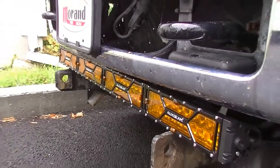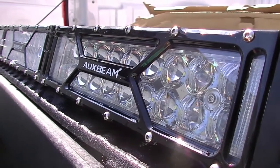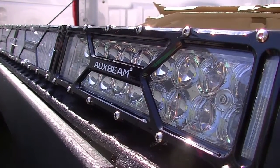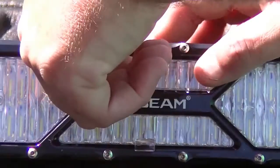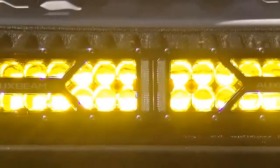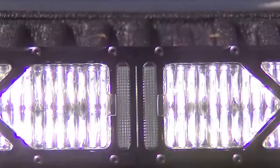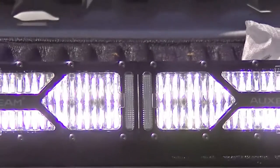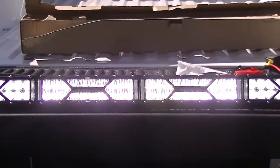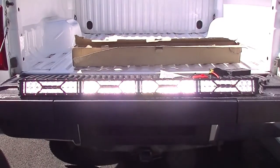The light itself in the box comes with two sets of clear diffusers that will allow you to change two of the portioned areas to floodlight. You'll have to buy different lenses separately. I recommend a pair of clear diffusers to completely cover the clear parts of the light that you'll be missing — that will add to the two that you already have. In all, you have to buy four sets of these diffusers to completely cover the light.